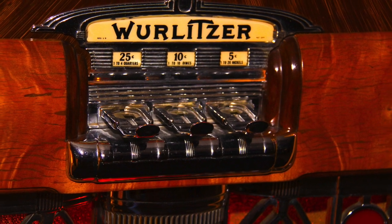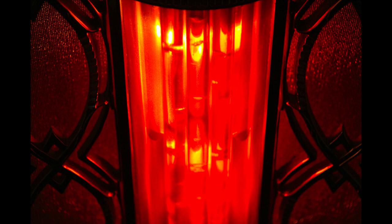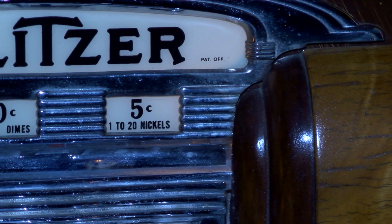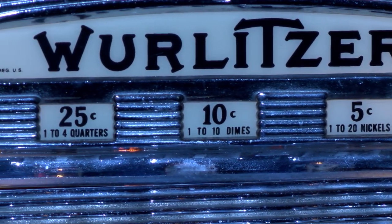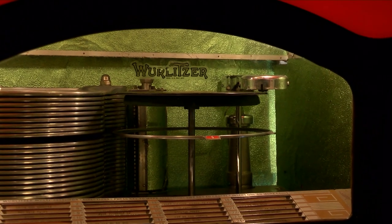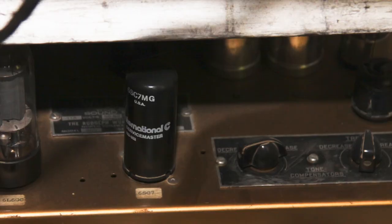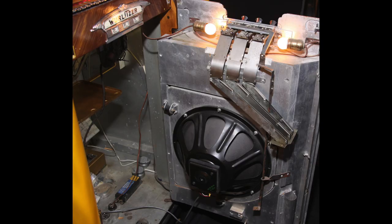The cabinet was made of high-quality walnut veneer. The grill housed a series of red discs that adorned the entire front to provide a brilliant overall glow that gave the machine a beautiful presence. The Model 800 used the Simplex 24-selection 78 rpm mechanism matched to an 18-watt tube amplifier and a 15-inch Motorola dynamic range speaker.